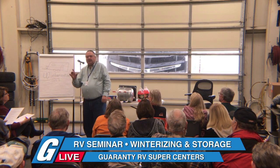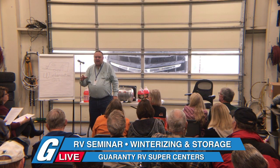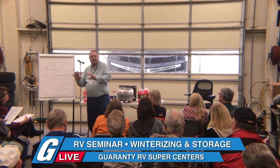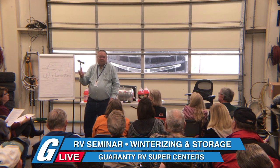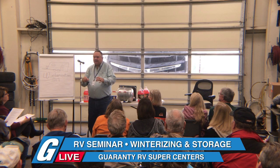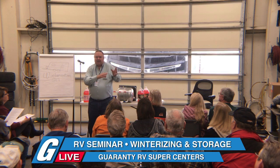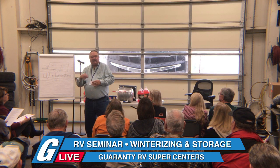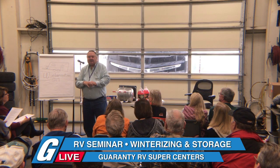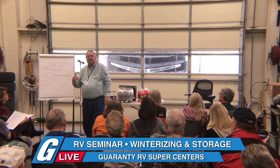And that brings up another question. I grew up in Idaho, and it gets cold there, so I learned all of this the hard way. If you put a little bit of stuff in your holding tanks, it runs right down to the termination where the black ABS plastic is. Through the years of RV ownership you break one of the ears off your termination cap. Well, don't throw it away. Take a drill and drill a bunch of little holes in it and then put it back on after you've winterized it. That way there's air coming in and out and the tank can dry out. Any moisture in there will run out, but cats and mice can't crawl up in there and make a nest. So anyway, we're not trying to get any kind of fluids at all into the tanks. We want to drain them.